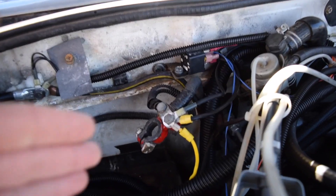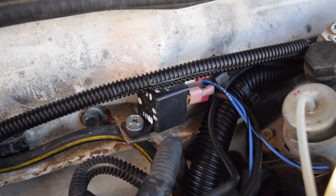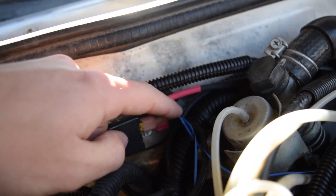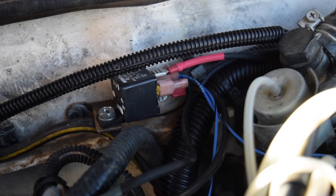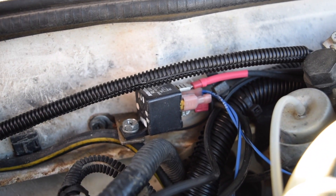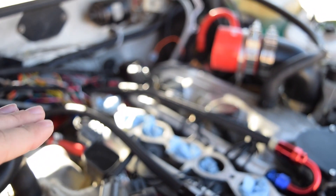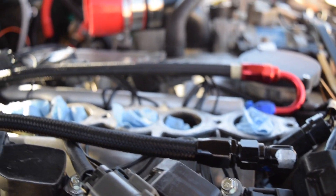One thing I did — this is the positive battery terminal right off to the side. This is a relay that I have, triggered by a wire coming from the inside. It's actually the nitrous wire, but it doesn't go to the nitrous ECU. It just comes off my steering column and turns this on. So whenever I turn the key into the on position, I get switched 12 volts to everything I need in here. We have that coming out and it goes to the injectors, and it also goes to the coils.